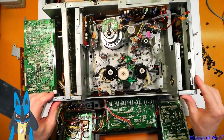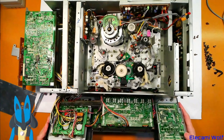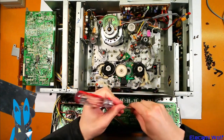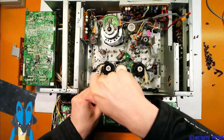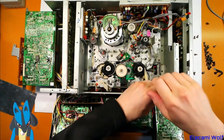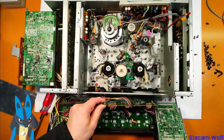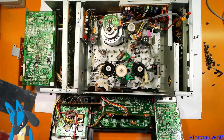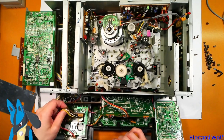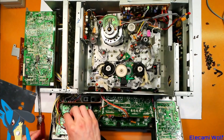There's the front panel with lots of stuff on it — it's got its own whole CPU thing. It says 'Front CPU' right there on the label, and it's one of those NEC DIP type CPUs. There's the board with the meters, because there are audio recording level adjustments on the front for normal and hi-fi audio, so all those signals have to come out to there. And the counter display board.